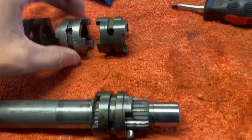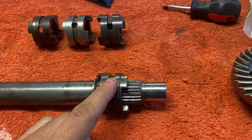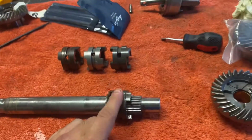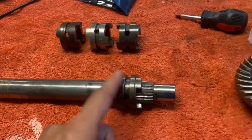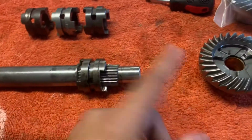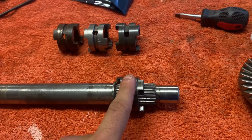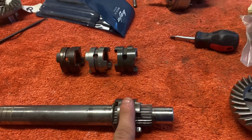So anyway, I had to get a new part, but I just wasn't going to front the $1,000+ to get the whole gear set. I thought this time I'm just going to replace the whole damn thing. So just to be on the safe side, rather than just doing the dog, which seems to be just wearing, probably because it's an aftermarket dog and it's probably not machined correctly to the forward and reverse gear and so on, I decided to just go and bite the bullet and get a full set. But I'm just not going to front the few $1,000s. Literally the full set costs more than the engine is actually worth secondhand.